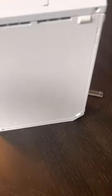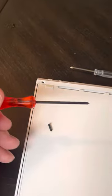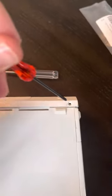First, you're going to need a tri-wing screwdriver. There are two screws with those three slots on the back of the Wii, sort of on the front cover of the disc. You can get a tri-wing screwdriver on Amazon for $4 or $5. You see the tip there, and you want to take out the two screws that are located here.